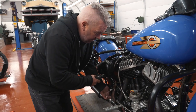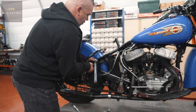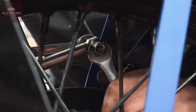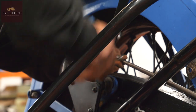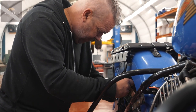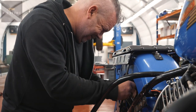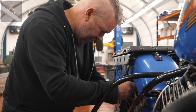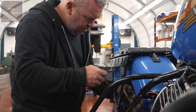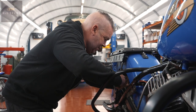Let's kick start off — I've already taken the bolt out of that because I stole it. Your chain guard off — this should just be a clevis pin and a split pin that comes off. Instead you've got a nut and a bolt that are actually mismatched, so it's rammed together. If you're going to put a nut and bolt in it, at least put one in that actually works.